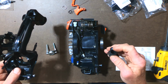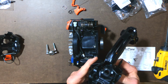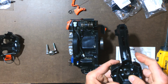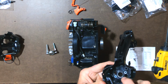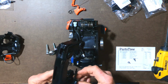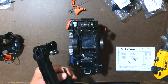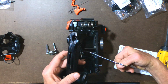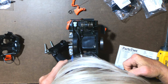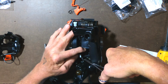This is why you keep that collar out of there, because you have to install it through the bottom of the rear handle, just like that. Once that's in, you can put that piece in place. Just like that. So it's in there now. Then what I want to do is get these hoses connected, and I'm going to recruit the help of some hemostats. Let's get these going. I'm going to hook the black one up to the black, and the white one here up to the white.